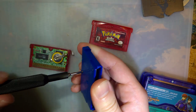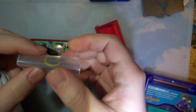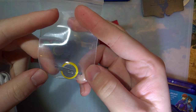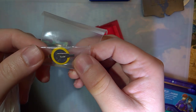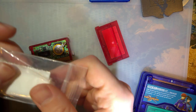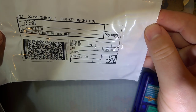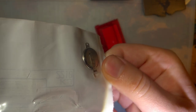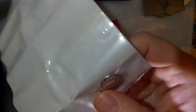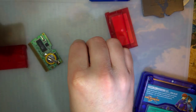It's just a regular tri-point screw. For the replacement, you can order cheap tabbed batteries on AliExpress or eBay — off-brand ones work fine, but clearly the one I've already got in here is already dead. Another option — and this is my very last one — is to purchase Panasonic lithium 3-volt coin cells on DigiKey. These are much higher quality with much better life expectancy, but they don't have the little yellow band on them. That's just a visual thing; it doesn't make any difference. I'm going to use the cheap battery since I'm not actually going to play this game.